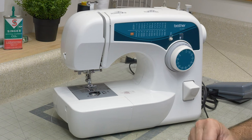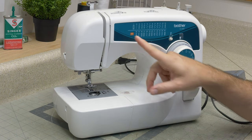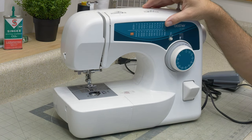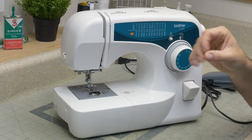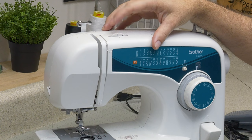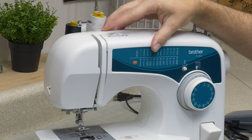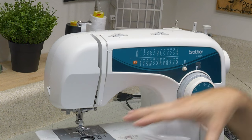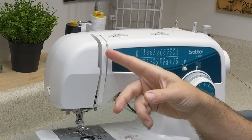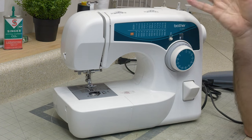It's a pretty good machine, so we're going to take a look at it and see if we can figure out what's going on. I haven't changed any settings. Right now it's set on two, which is a straight stitch. Our stitch length is set at three. Our stitch width is set in the middle, which it should be for your straight stitch, because this will actually move your needle left and right. We have our tension set at seven. That starts to raise an alarm because the maximum is nine and it was set at seven — should be at four. So maybe we have a tension issue, maybe our tension discs are fouled with some thread, or maybe they're dirty, or maybe we have some bobbin tension issues. You never really know until you get into it.